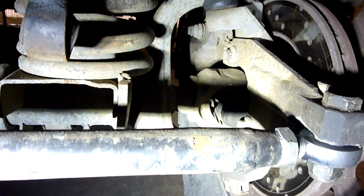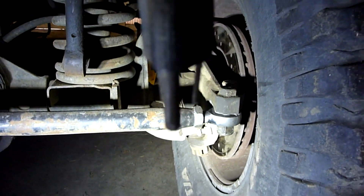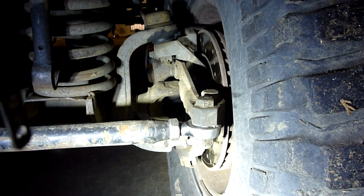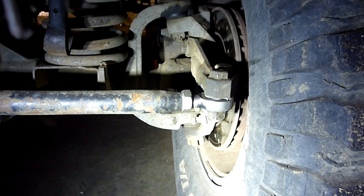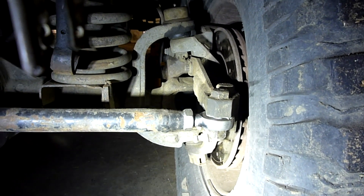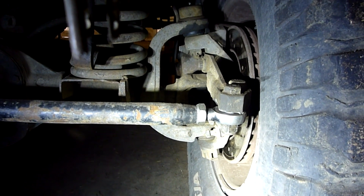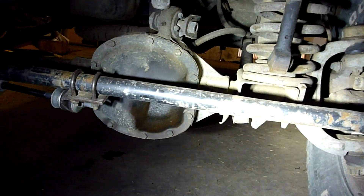The plate goes back in and bolts into the original hubs — the bolts that hold the hub on go through the back, there are three bolts there. I've found this to be extremely sturdy; haven't had any problems at all. At the end of that one-inch stock there's a bolt going through which bolts the heim joint on, and that basically extends the radius or the fulcrum point for turning the tires.